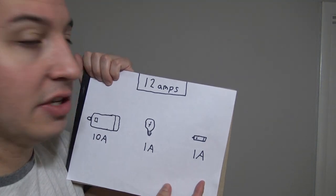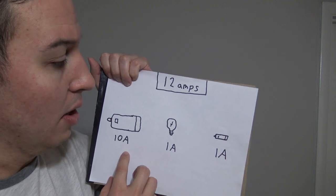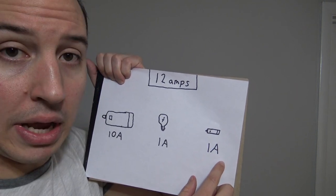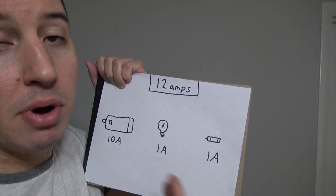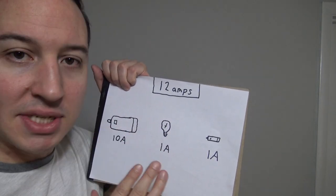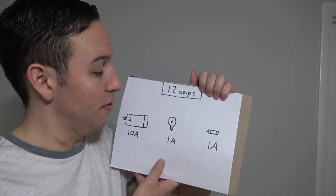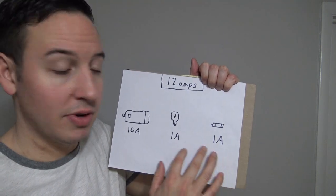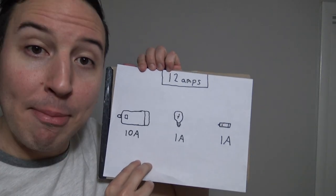If you see a specification that says 12 amps, it's referring to all of the electrical parts of the vacuum cleaner combined, not just the motor itself. You could have a spec that says 12 amps, and the actual motor itself is only 10 amps. The other electrical components — like a smaller motor in the nozzle where the beater bar is that takes 1 amp, or a light bulb that takes 1 amp — account for the remaining amperage. This is always the case unless it's specifically stated otherwise. So if you want to compare motor amps to motor amps, or convert amps over to watts, you need to subtract those other electrical components and use just the motor's number.